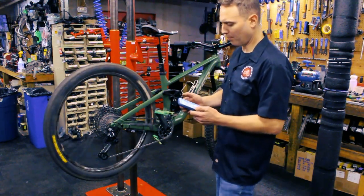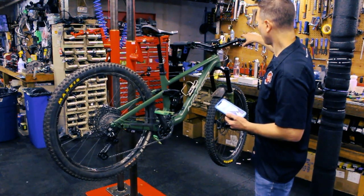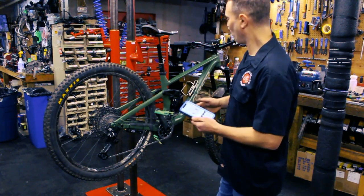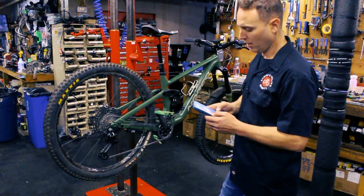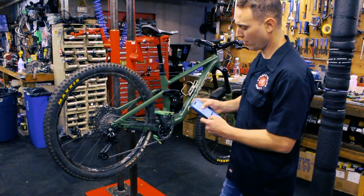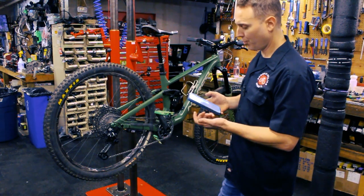In the settings app there are a lot of cool features. The shifter direction can be set so this button goes down the cassette and this one goes up, or you can reverse it. It has a quick shift option — right now I have it set up so when you hold the shifter it jumps up or down two gears, but you can do up to five gears at once. You can also adjust the button press delay, controlling how quickly the shifter reacts after you press the button.